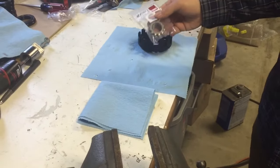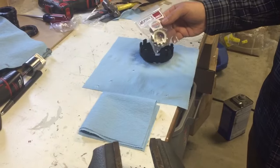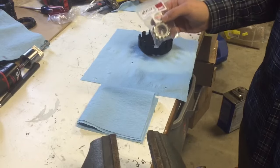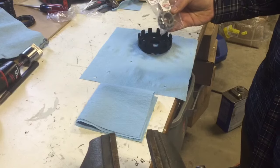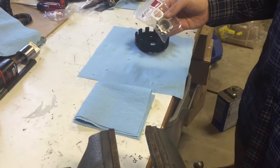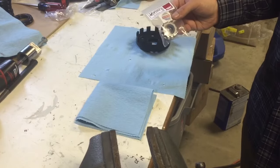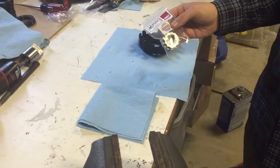One thing to mention is that we get all of our sprockets from a company called SMC. They make centrifugal racing clutches for go-karts and we use their sprockets in our 3D manual clutch. We can supply sprockets from 12 teeth on up in both number 35 pitch and 428 pitch, and we are currently planning on offering sprockets in the 40 and 41 pitches as well.